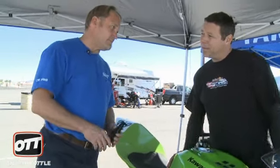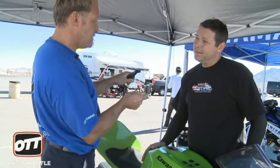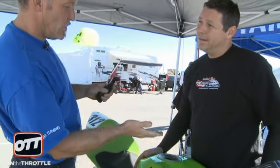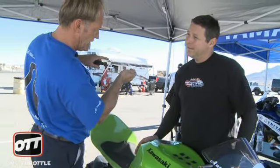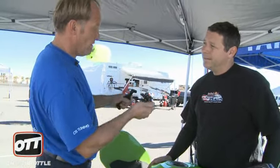On the solo, do you want me to play with the brake a little bit? What I want you to notice is, when you let go of the brake, do you feel it pop? With these, you need the front end taller because the mechanical bottom out is so big. You want it to come back to allow you to finish a corner. What you don't want is for it to pop back and induce a sudden geometry change. We could always add a turn — a turn and off, a preload in the front. We've got to make sure that in terms of the rebound, it doesn't come back in your face when you let go of the brakes, because then you've got a sudden geometry change. You don't want ping, and then oop.